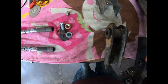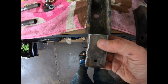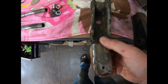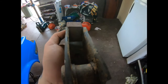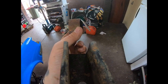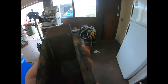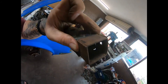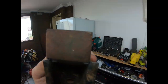It's just about spot on. What I'm going to do now is cut another piece — this top bit is about an inch and a bit long — so that's like a flap. I'll belt the flap down into that cavity and weld it down there. I'll make one up and then show you. I should have done another flap on the other side but it's all good — I've got a flat bar, I'll weld on a tag. Basically that'll fit in like so, and we'll extend it 30mm.